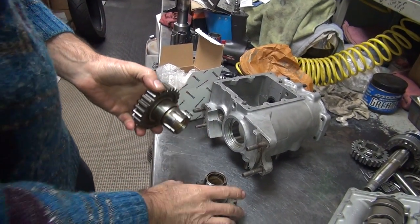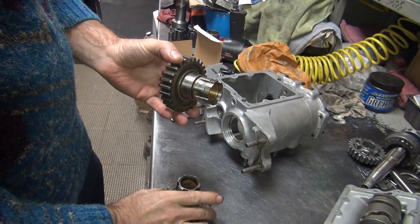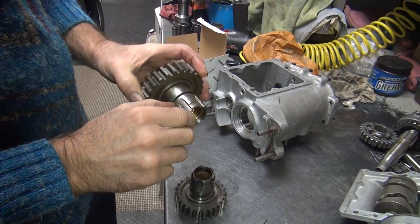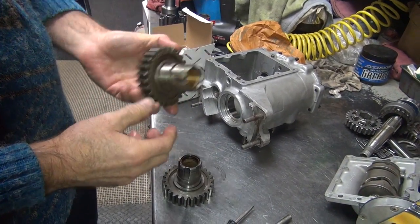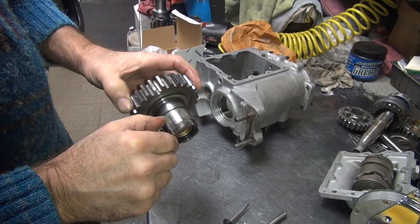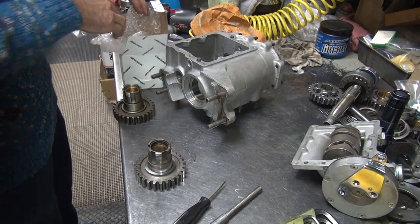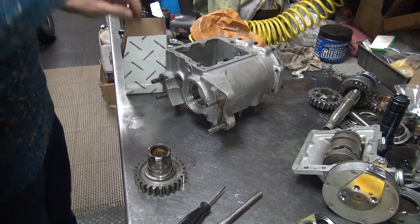Groove. So you have to cut deeper. And you just cut a deeper groove on this one? It's heat-treated, so it's hard to do. Okay. We can attempt to do that, or we can just buy another gear. Or just put it together and hope it doesn't leak. There's lots of repairs and fancy tricks you can do on these things. Putting that gear in there is the best one.